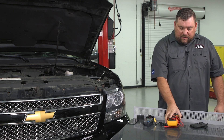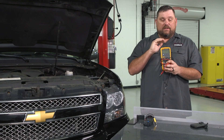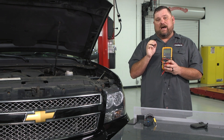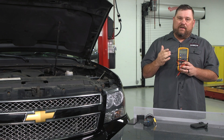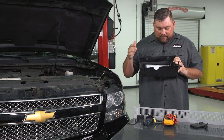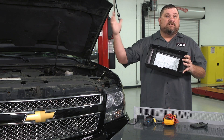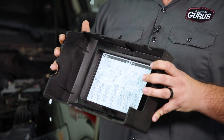We've been using this technique for a while — we grab our meter and do voltage drop tests across the fuses to determine which fuse has current flowing through it, keeping everything awake and drawing on the battery. We find that voltage drop because of the resistance inside a fuse; it's very small but it does cause a voltage drop. The problem nowadays is these newer vehicles have so many fuses — take this 2012 Suburban, it has 30-plus fuses in the box, and other cars may have 50 or 60, making it very time-consuming to go fuse by fuse.